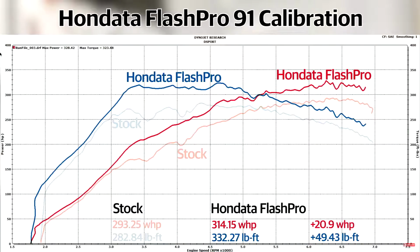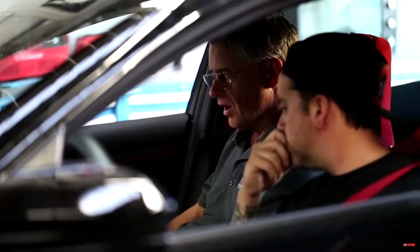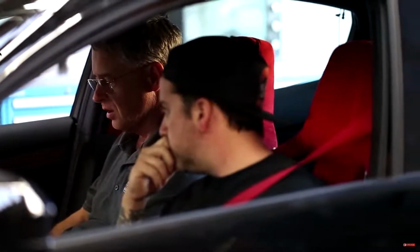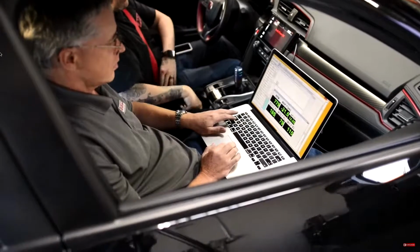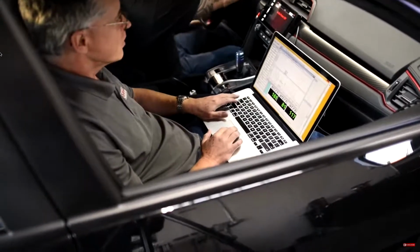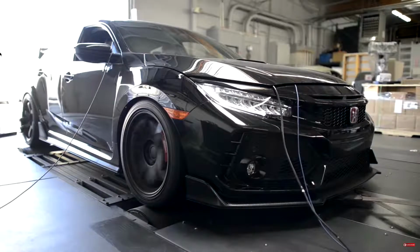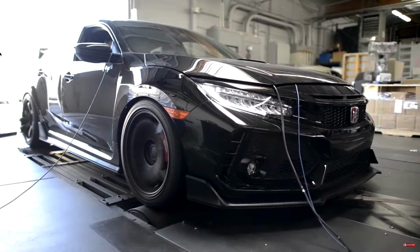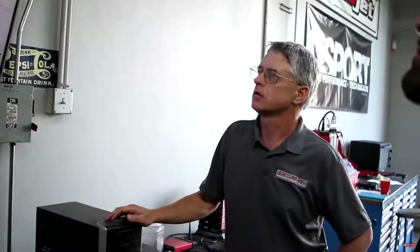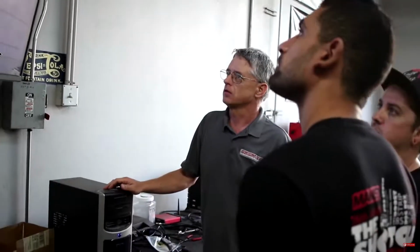So let's go in. We've taken the air charge, which is effectively the amount of boost that we can put in, and we've upped that by 5%. Does that give us any more power? In fact, it doesn't. Our calibration is pretty well optimized for the boost level. So adding that 5% more boost has given us absolutely no more power. Okay, negative results are also good.